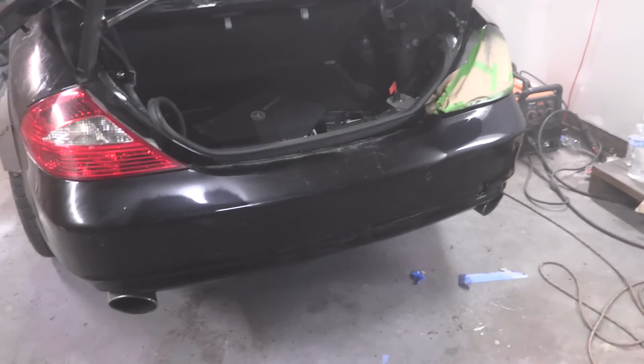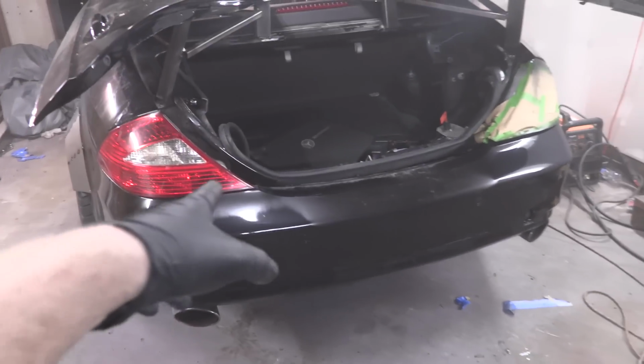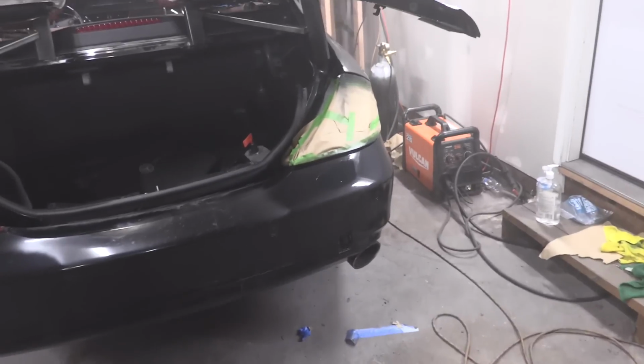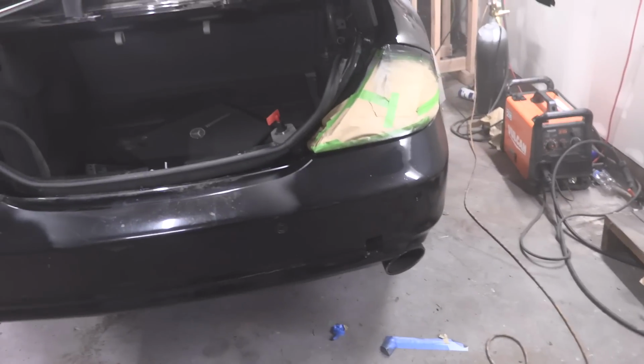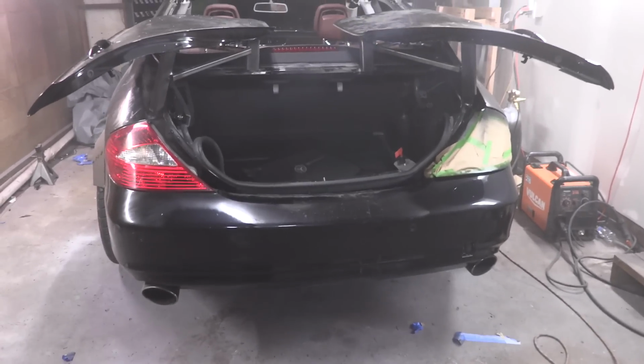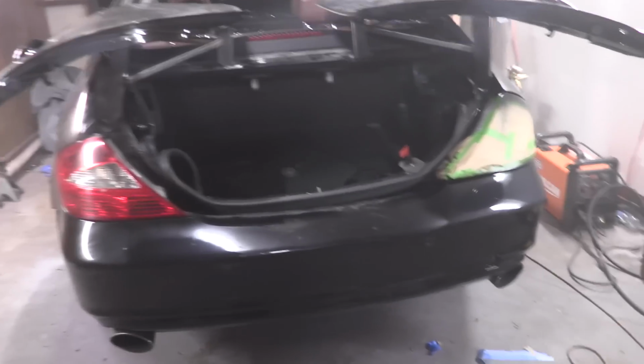All right, that worked pretty well. You can obviously see where the misty stuff needs to be wet sanded in, and this whole thing needs to be blended together, but it looks a whole lot better than just that flat primer. When you stand further back and are not in a well-lit paint booth, this will definitely blend in a lot better. So it looks really good.